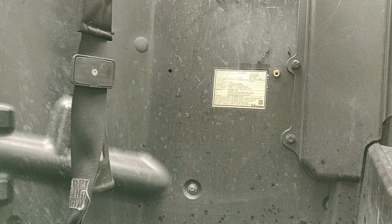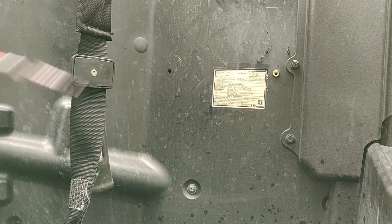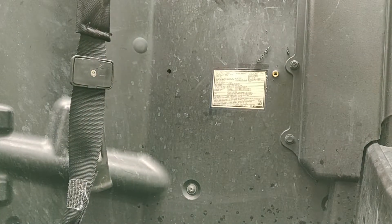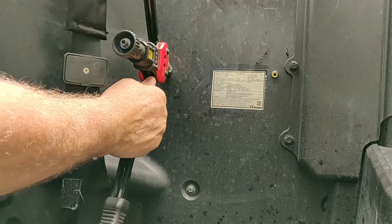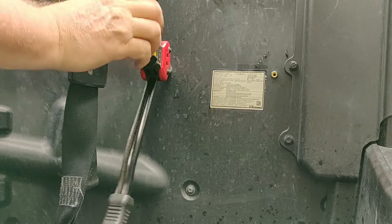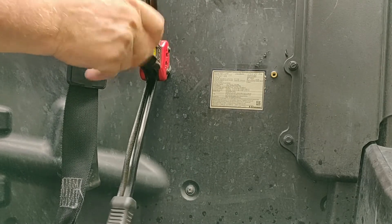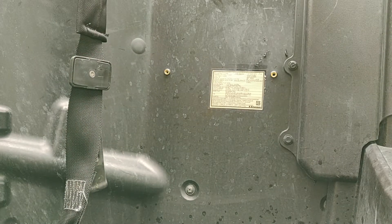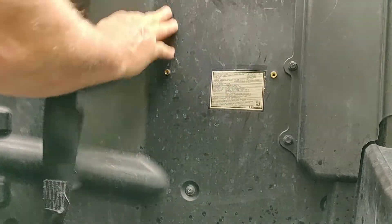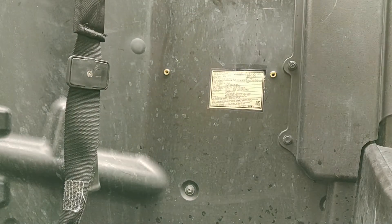Let me show you how easy it is to put in a nutsert — I've already got this drilled out. That simple: put it in, squeeze it, undo it, screw it — and you have a place to screw into. I've got four of them in, all done. Looks professional and it's going to be a real solid mounting for that amp.